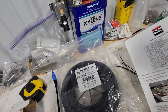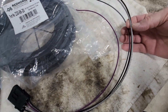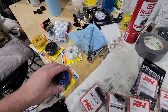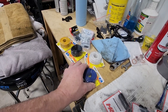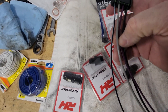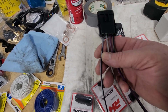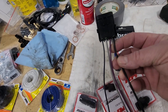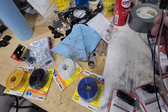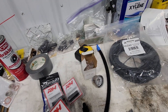The instructions say you need to use 12-gauge wire, but everything in this pigtail is 16-gauge. I talked to Holley and they said 16-gauge is fine. My wire colors aren't going to be identical — where this pigtail attaches on the Sniper EFI harness it powers into a blue wire, so the gray wire here becomes blue. The black with white stripe is a ground for the fuel level gauge — I'll use white. Solid black stays black. The purple wire is power for the fuel level gauge — I'll switch that to yellow.